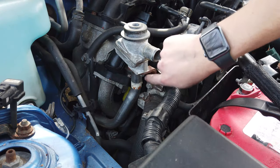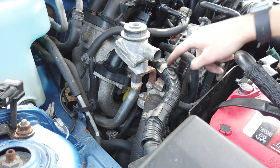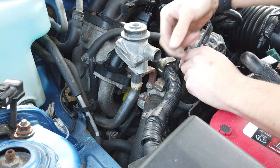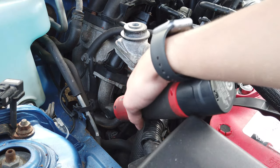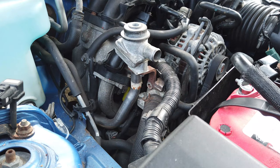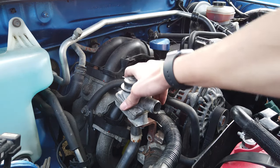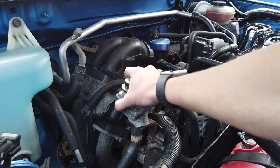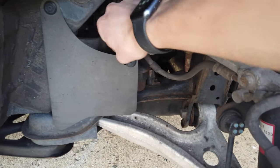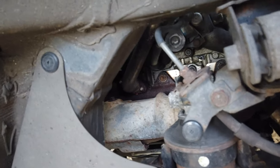The next thing is to remove the bolt for the check valve. We'll start by taking this clip off because it's connected down to this bracket, using the electric ratchet with a short extension and a 10mm. That bolt's out, and then there's also this little tube that you just pull off just like that. We can wiggle this a little bit. Then we move on to the wheel well where we took the wheel off — just take this little flap and move it out of the way.